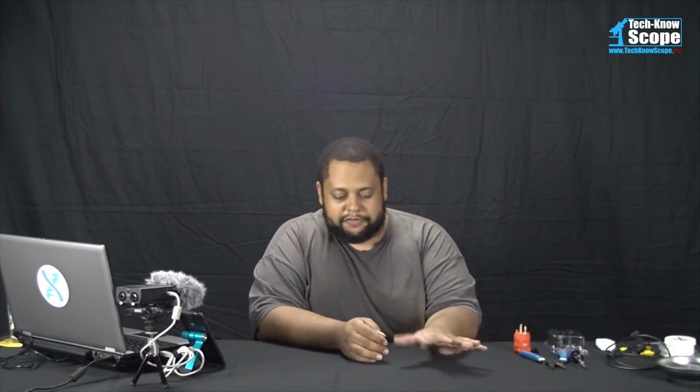Electrocution happens when high voltage, high enough to travel through your body, travels from one side or through vital organs in your body and shuts them down, whether it be your heart, your brain, or whatever it may be. So the worst thing you could ever do is to have voltage going across, especially the midsection of your body. You touch something this side and it's coming out this side, it could kill you if the voltage is high enough and there's enough current flowing. Now, if you get it across your hand or something, it could hurt a lot, it could burn you, it could do some serious damage, but it's a lot less likely to actually kill you because it's not flowing through your body. That's the crucial thing. You don't want it flowing through your body.